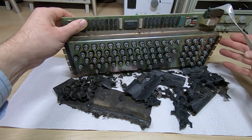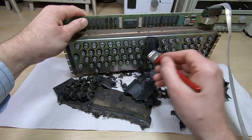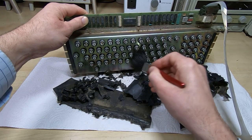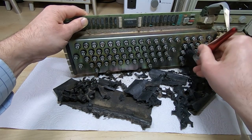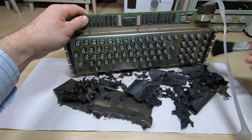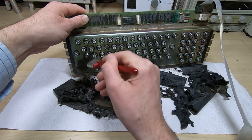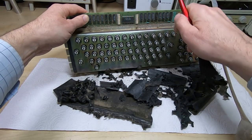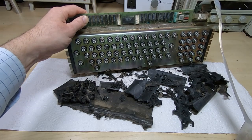Keeping it upside down, all the dirt and debris fall away from the keyboard, and now just a quick brush will get rid of anything loose that's left sticking to the keys. I'm trying to brush it away from the keys rather than down into the keyboard, so all the dirt and muck that the membrane collected over the life of the machine is now being got rid of rather than dropping into the keyboard. I've finished cleaning this off and I can now remove this part and take the bottom cover off.